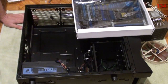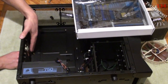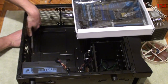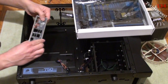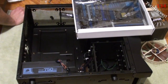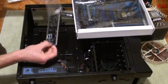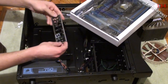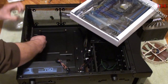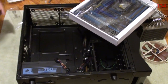Here is the brand new motherboard. It kind of goes with the blue theme I have in this build, which fits a little bit better than the red one. I'm going to pop out the old IO shield from the old motherboard, put that to the side, and put the new IO shield in. I'll match everything up and snap it in.